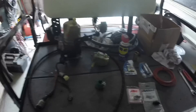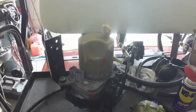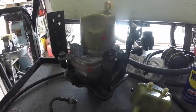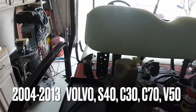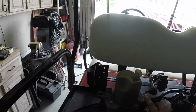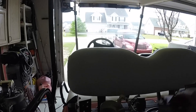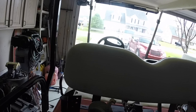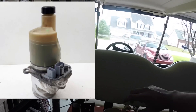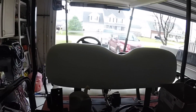This is pretty much most of the parts you'll need for this conversion. To start off, this is the electric pump - a Volvo power steering pump out of a Volvo S60. Some S80s came with them too, but just research a Volvo electric power steering pump. They make different versions. This one has an external reservoir connected by a hose so the reservoir is located separately. But they also make a version where instead of a fitting for a hose it's a screw-on cap, so the reservoir is essentially built into the pump.